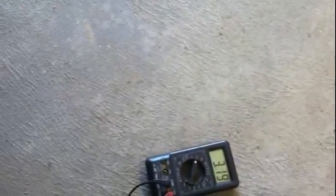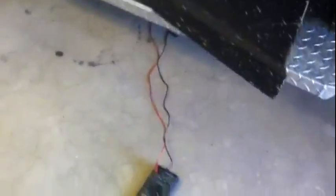By the way, there's no door panel on this door and I've hit my back on that about seven times. My dad always said if you're going to be dumb, you've got to be tough — so I'm A-plus there. You're going to lose a couple volts through the switch because they're contacts, and we'll see about starting. I'm going to start right now. Yup. So we've got a broken wire in that harness going up to the starter solenoid. I'm not going to show you how to run that wire or put it in a loom. You just need to know that's how you figure it out.